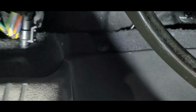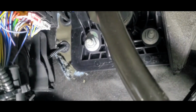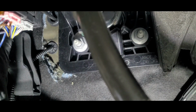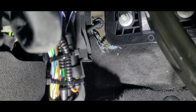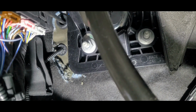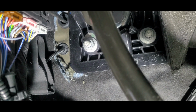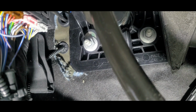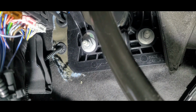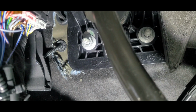Alrighty, we're in the truck right now. And bear with me here. There's your hole. That's a 3/4 grommet we put in that hole right there. Don't never mind about what we're doing to the BCM. Right there, that's where you can drill a 3/4 hole. You could drill a bigger hole if you need. We took away the heat shield a little bit with a razor blade and drilled the hole, put a grommet in it, and away you go. So that's how you can get them grill lights into the truck so you can activate them with a switch. That's how you mount the grill lights.